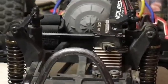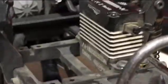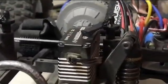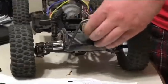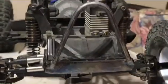Everyone's going to want to know what the servo is. Oh, it's the Power Hobby 760 MG. It's the high voltage one, so you have to run this BEC. And then you can change the BEC to run 6 volts, 7.2, or 8.4, I think. And at 8.4, it's 760 ounce-inches of torque, which is absolutely ridiculous. I think I have it set to either 6 or 7.2 volts right now, and if the front tires are in a bind and I turn, the whole truck lifts itself and moves, which is cool, but also puts me in some odd situations because of how powerful the servo is.